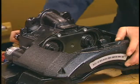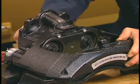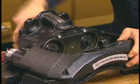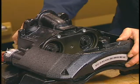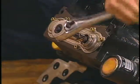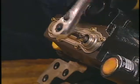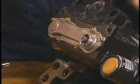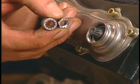As the shear adapter is being turned in this direction, it is overcoming the ball clutch torque of the internal adjuster. The slight feel of resistance and the clicking sound are both normal. However, if you continue to apply torque after the tappets have been fully retracted, the shear adapter is designed to fail in order to prevent damaging the internal adjuster.